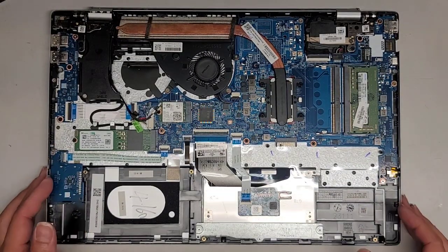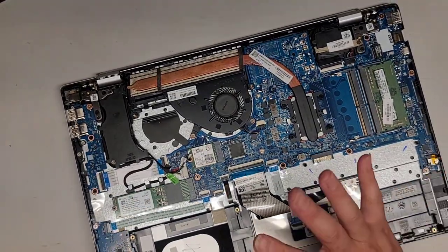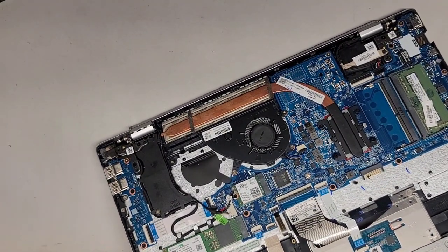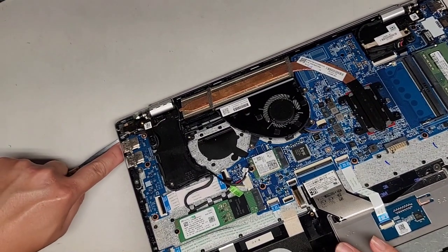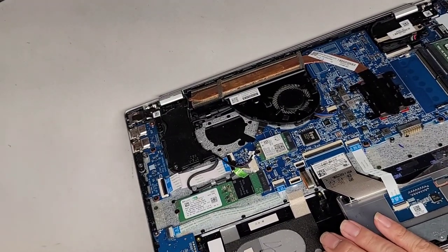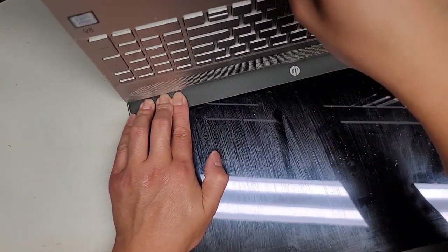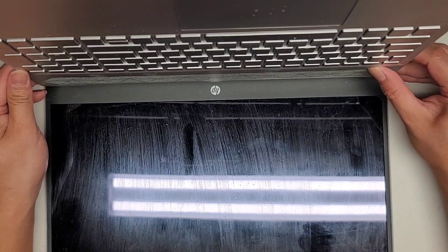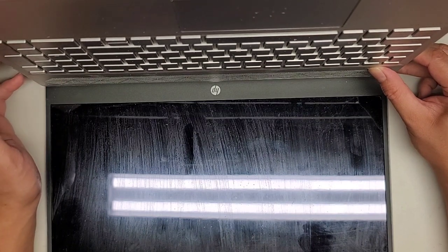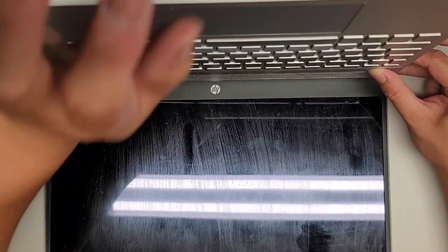I don't really need to take out all the other parts. After doing that, we're going to open it up and press and hold the power button to drain any residual power to make it safer to work on. I'm going to have to carefully open this up again, so let me get this thin tool in here to help hold where the hinge is. We're putting my finger as close as I can to the actual hinge area, then I can get my hand in there and keep the hinge held down while I open this up.